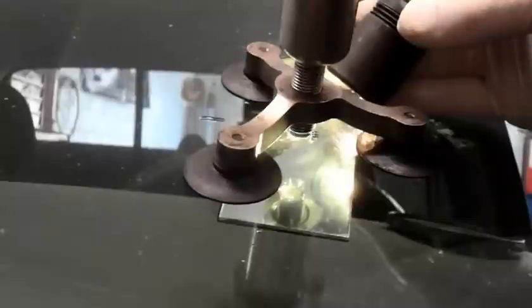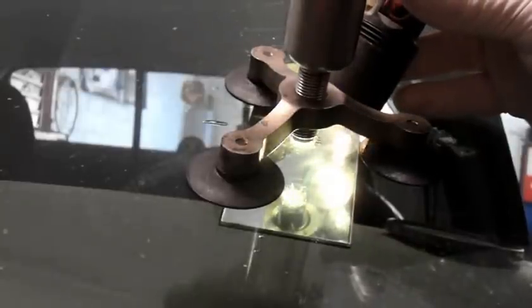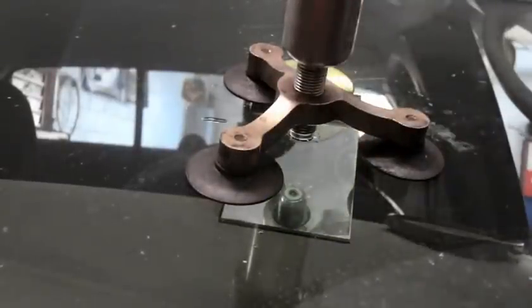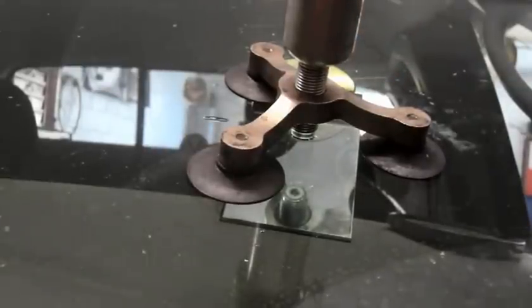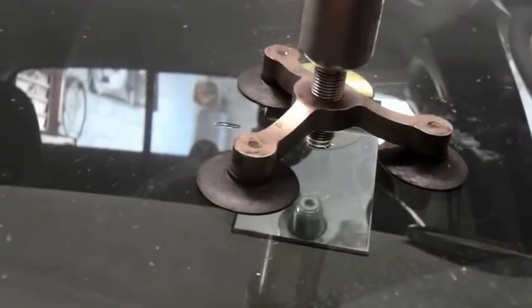Now after the air is pulled out of the window, we're going to hold the resin pump, loosen up the thumb wheel, and let the resin flow into the window. You can see it's starting to disappear in there. We're going to let that sit for just a minute to let the resin flow into all those little tiny passageways. You can see that it's almost totally gone right now. So we're going to let that resin flow in and then come right back.